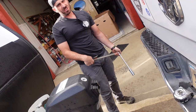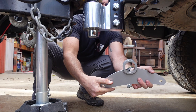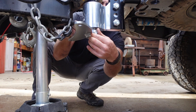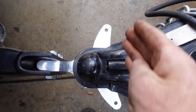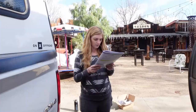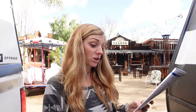You're going to take your pin — they're calling this the tension plate. Put it on here, and orient it so that from the driver's side you can always easily see that your pin is in and everything is lining up correctly. Then it says to look at a bird's-eye view of the tension plate to make sure it is close to perpendicular to the trailer frame — it even has a nice little diagram. It doesn't have to be perfect, but you want it as close as possible. With the trailer coupler locked and secured to the ball, extend your jack and raise the trailer an inch or two above the bumper height measurement, then attach the chain shackles and hand-tighten both shackle pins.